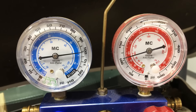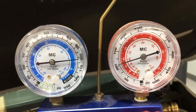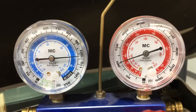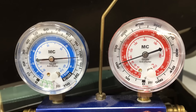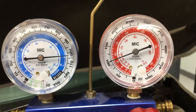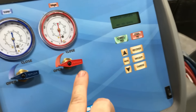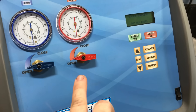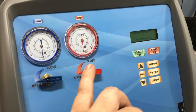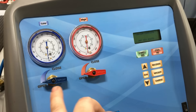I'm not even sure if this has an FOT or TXV system — I know Fords use FOT, and just about everybody else uses TXV, with newer Fords using TXV too. But either way, there's no restriction — we equalize just fine. So the very next thing I'm going to do is bust the machine out and suck down the system.